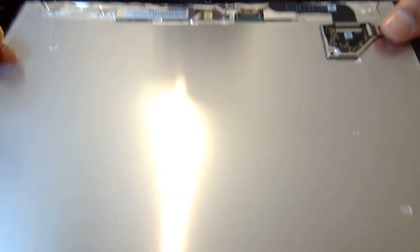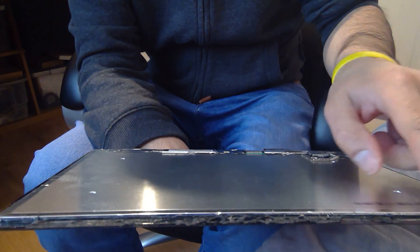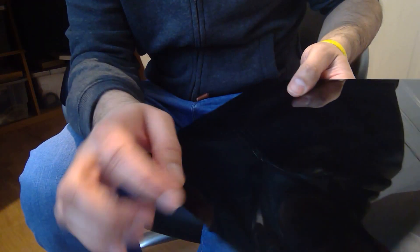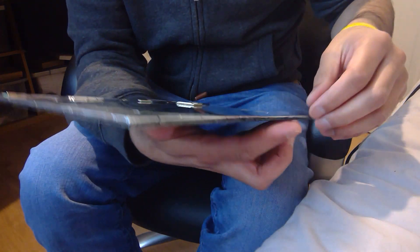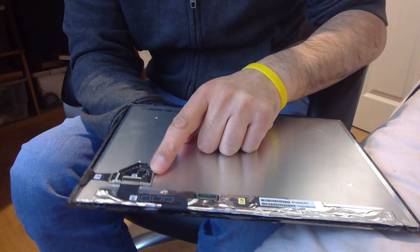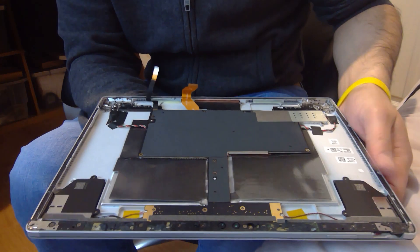The screen is actually perfect from a glass point of view — it's the internal display that got damaged when it was dropped. To remove the old adhesive I heat it up and take the glue off by hand — it does come off if you're careful. I'd warn against spraying anything in there because the spray can end up inside and takes a long time to disappear. That's how you take a screen off. When reassembling, always plug the display connector in first, the digitizer second, and test it before you seal it.